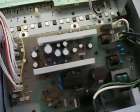Make sure it's not so far bent that it doesn't work properly. When you release the key, make sure it's touching the bottom plate and not the other plate. Make sure there's no bending — that'll be your basic alignment. Go over everything, make sure everything is correctly aligned, and you should be good to go. Once again, this is the Yamaha Motif 6, old classic series, and we're getting ready to put it back together and try it out.